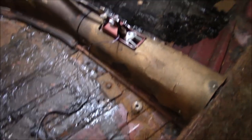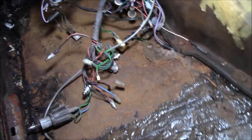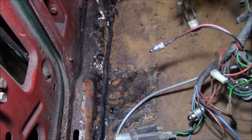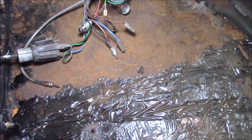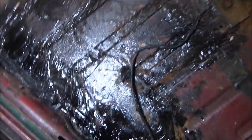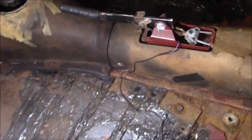We're just taking a look at the floors now that they've been vacuumed up and it looks much cleaner. The driver's side floor has had some pretty bad repairs — it's a non-original floor. Looks like they just put a solid steel plate in there, overlaid on top of the old floor, because you can see the depression for the body mounting bolts and they've just got silicone around that, which looks quite suspect. The passenger side has the original floor — you can see the depressions. Seen better days but probably serviceable.